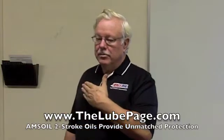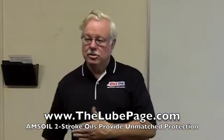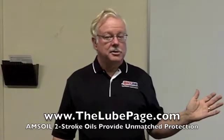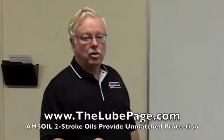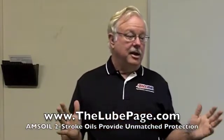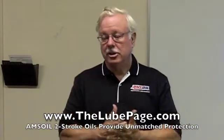So if I got a 100 horsepower motor, I just lost 10 horsepower because I can't get the exhaust out. So the proficient thing to do with motors they used to do in the past, when you brought it in for an annual service, for a guy that used a two-stroke motor quite a lot, the boat repair shop said, okay, we need to decarbon the engine and do all this stuff, because that's what they're doing, cleaning it out. It was a standard procedure. You run these high-performance two-stroke oils that AMSOIL has, and the cleaning is virtually unnecessary, and you don't end up with stuck rings. You end up with a very, very clean inside of the engine.